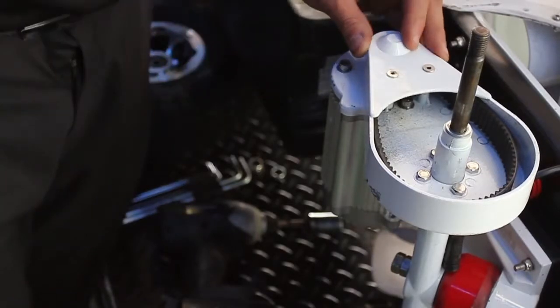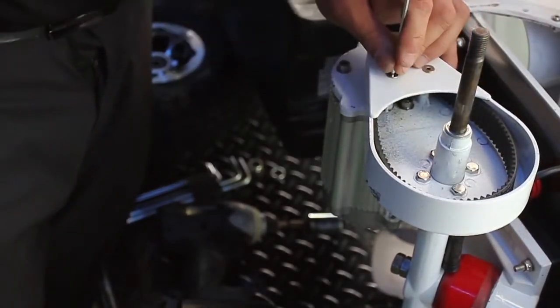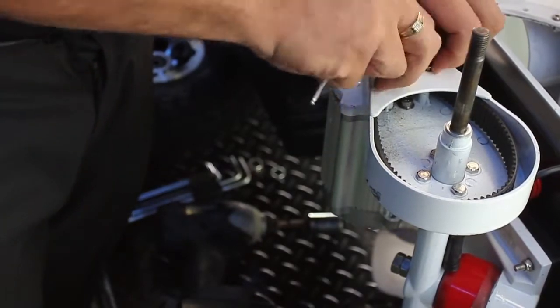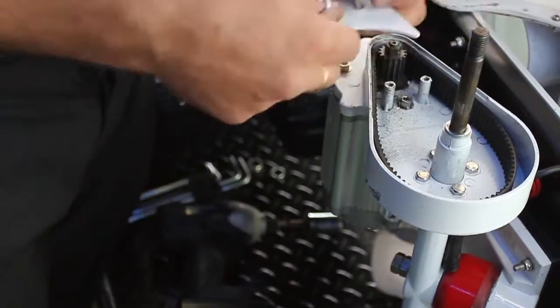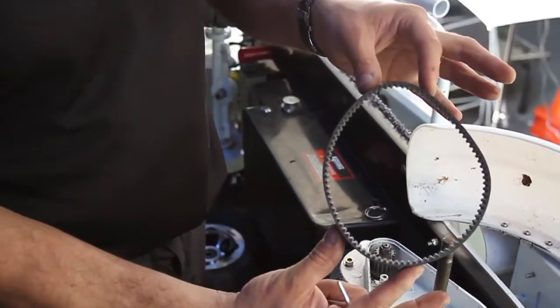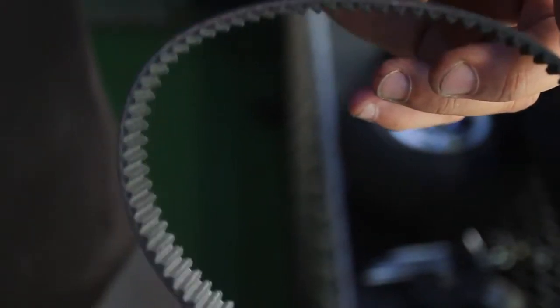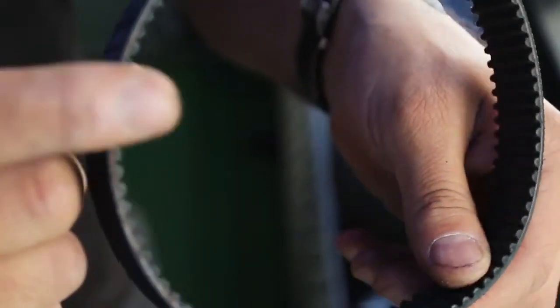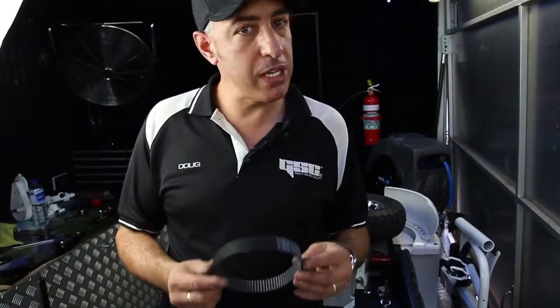The second job is to remove the belt to replace the drive belt — very straightforward. With your 3mm Allen key, simply remove the belt. Check for wear and tear and inspect that the belt is not damaged. Give the casing a little clean just to remove any dust or fine particles that may have entered. After inspection, belt replacement is very straightforward.